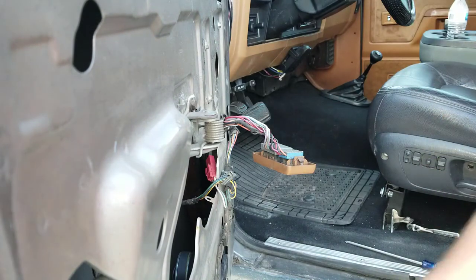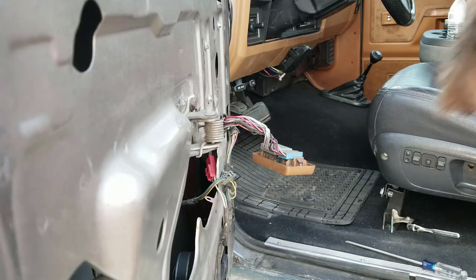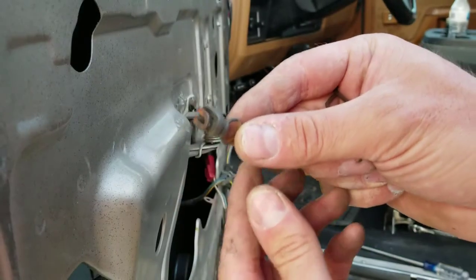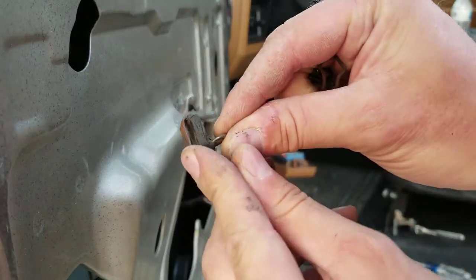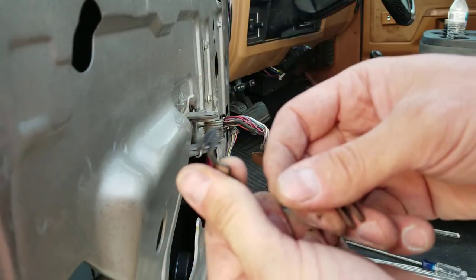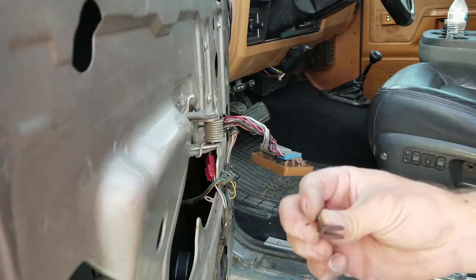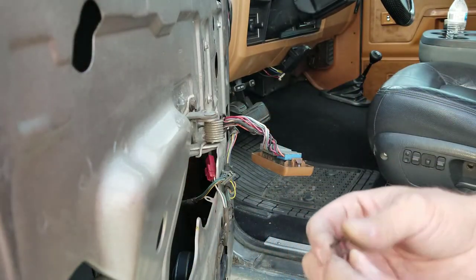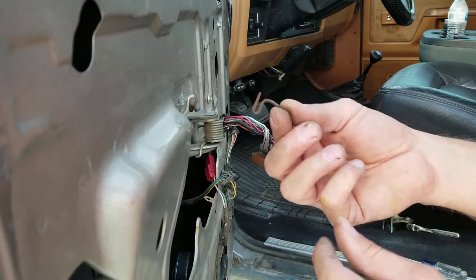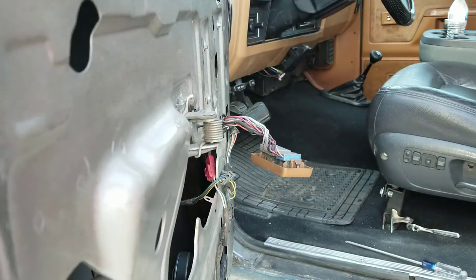Be careful - I had three different tabs fall. This is what the stock tab looks like, with a little rubber on it. This is one I need to replace. You can pick bags of these up at Napa or on eBay. If they're not gripping onto the panel well enough, just grab some pliers and kind of pinch it shut just a little bit. Then these just sneak right into that hole and go through there.